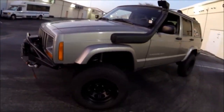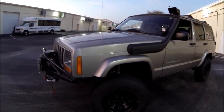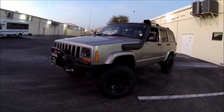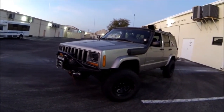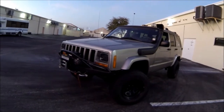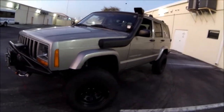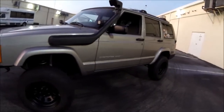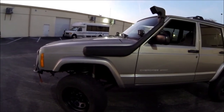The previous owner had bought a seal but never put it in. I looked it up — it's actually not that hard. Four Wheeler Magazine did an article on it and Bleepin' Jeep had one too, so I followed those. Being mechanically inclined, it wasn't that bad. The only thing that freaked me out was hammering out the top half of the O-ring. Once you get the oil pan and the girdle off and the cap off, the bottom one was fine — I tapped it out and it came right out with the first couple taps and it was in rough shape.